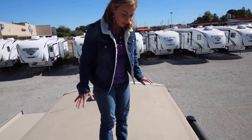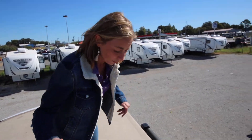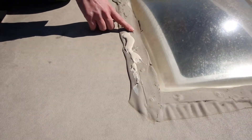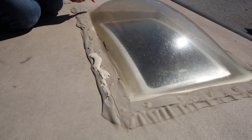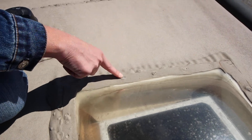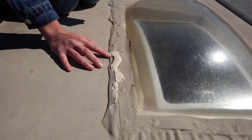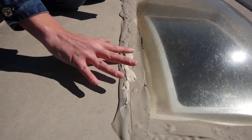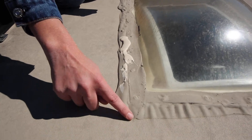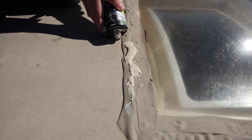What we're going to do next is look for any holes or spaces in our lap sealant or self-leveler. As you can see right here, I already came through and did a couple of little holes I saw along the skylight. You can see there's a screw exposed right here too — it's really important to get those covered up. That'll start breeding rust and spread throughout the skylight area. This doesn't have to be pretty; it is self-leveler so it will level itself out. If you want to do a straight line, that's up to you. If we are going to do a sealant on the whole skylight, you're going to want to run a line on the exterior of the existing lap sealant.